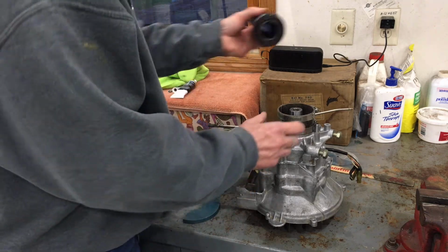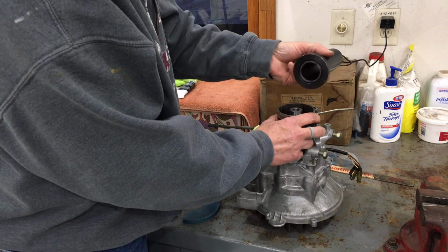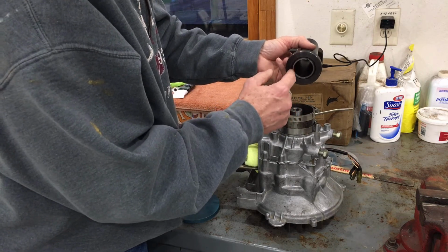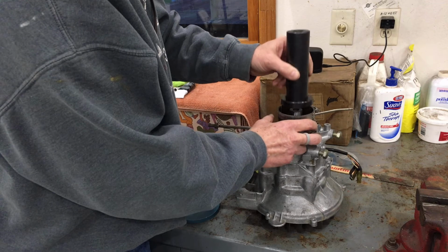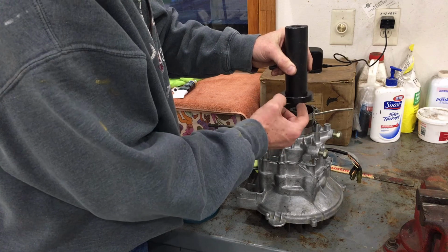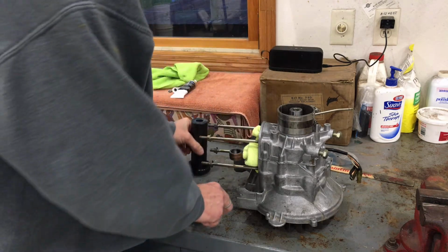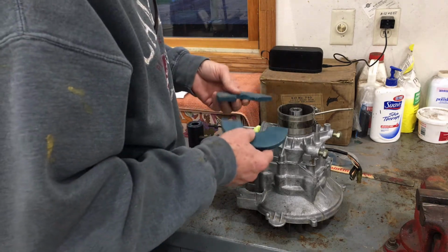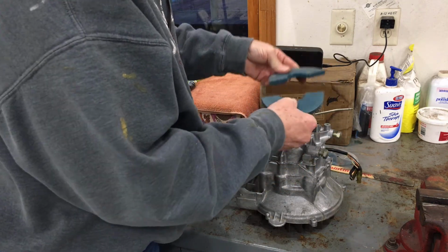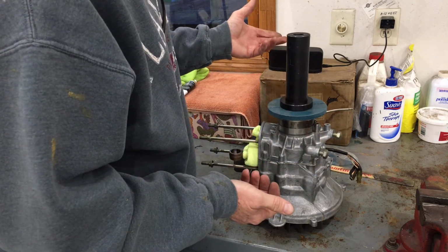Now, the Tusk tool, however, at least this one in particular, this collar, and I sense that there are different ones available because this will screw off and maybe you can get a wider diameter. Not having one, you have to come up with a means to stop this from going inside, and a means to allow this to apply pressure to the collar. So in an earlier video you saw me with an old 37 Chevy tool. Here's actually another one. It's basically just a press plate, and you can MacGyver one out of a piece of steel or whatnot, and it's going to sit like that.